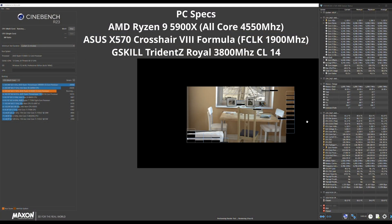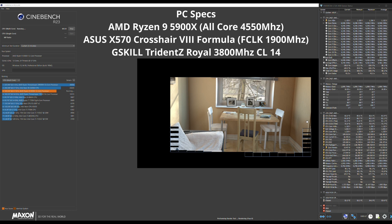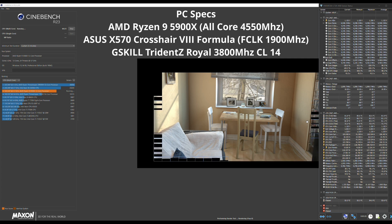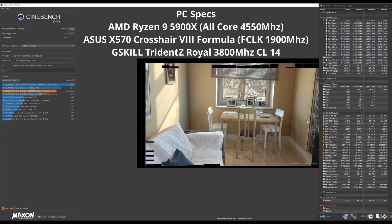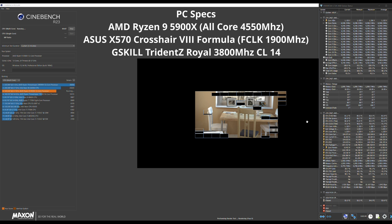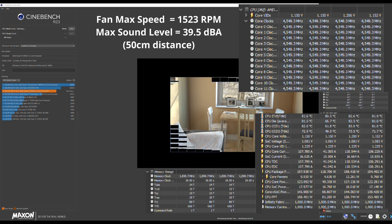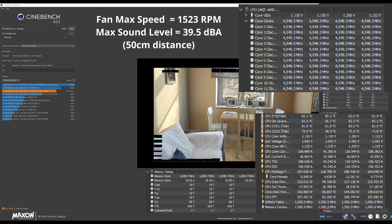Now onto the performance. I set the ambient room temperature to 21°C and overclocked the AMD Ryzen 9 5900X to an all-core 4550MHz. Despite overclocking the CPU, the cooler managed to keep the CPU cool at 81°C, only touching a max temperature of 83°C. Considering this air cooler is enclosed in a Lian Li PC-O11 Dynamic case — which is not the best case for an air-cooled CPU — the Scythe Mugen 5 has managed to pull it off, giving decent cooling performance at a budget price. The cooler was also quite inaudible. I tested the fan at its max RPM of approximately 1500 RPM with all case fans turned off, and my sound meter only read a max of 39.5 dBA at about 50 centimeters away from the cooler. So in essence, you won't be hearing this tower cooler even while gaming.